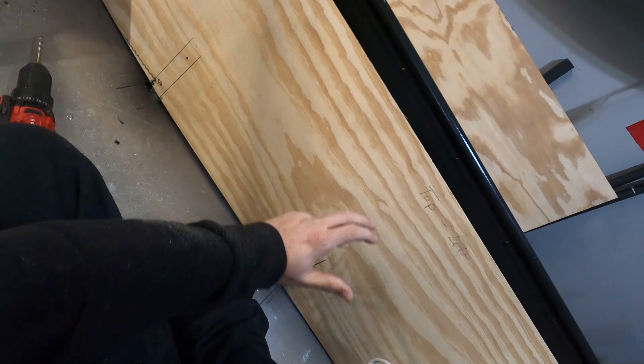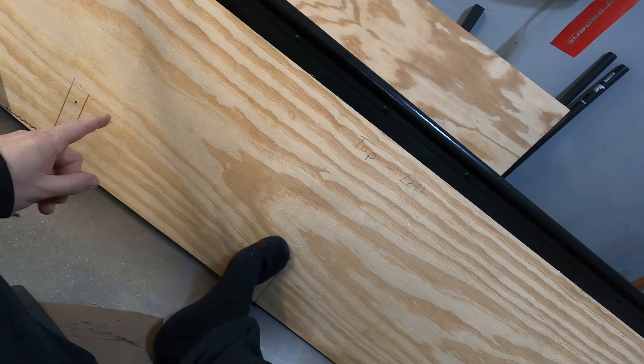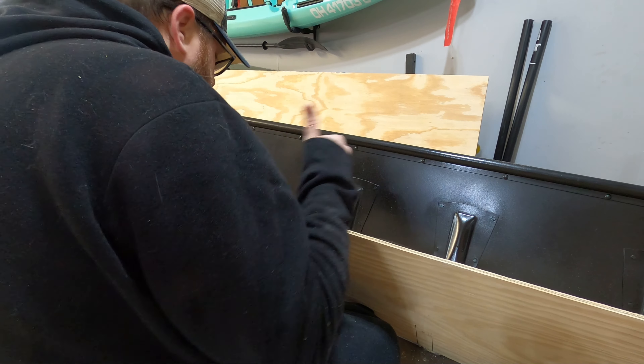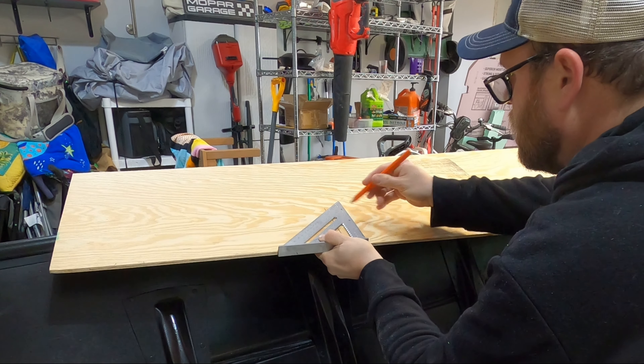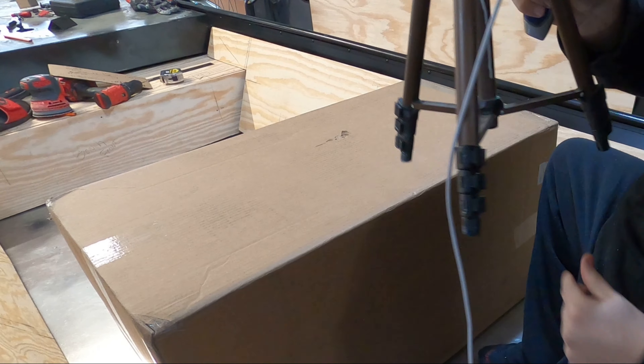Right now I am marking out where the ribs are. I use the openings at the bottom of the floor here to find the sides of the ribs, mark that out, and I'm drawing lines up. What I'm gonna do after that is put some mounting holes in the wood and then make sure that it lines up with the ribs before I actually drill into the ribs. I don't mind if there's an extra hole in the wood, but I don't want any extra holes in the boat — especially when we're this close to the side wall. I got my shoe wedged in the side there to make sure this stays in place, just putting pressure with my foot to make sure it's up against the wall. I checked all the drill holes I put into the wood to make sure it matches up with the rib, and it does, so I'm gonna go ahead and make my mounting holes. I got them right in the centers of the ribs — that looks really good.